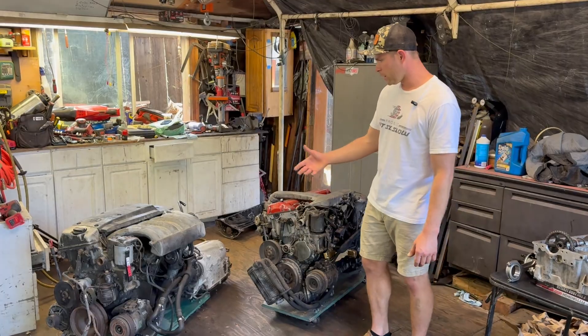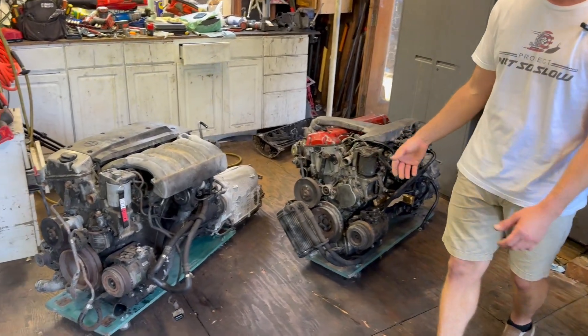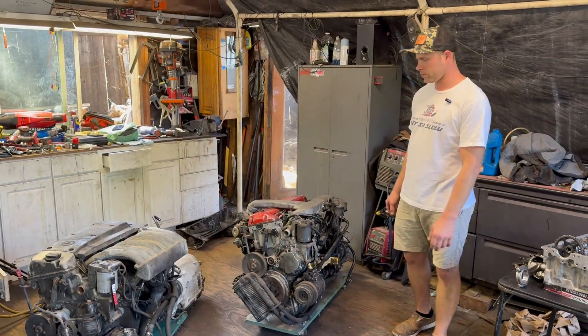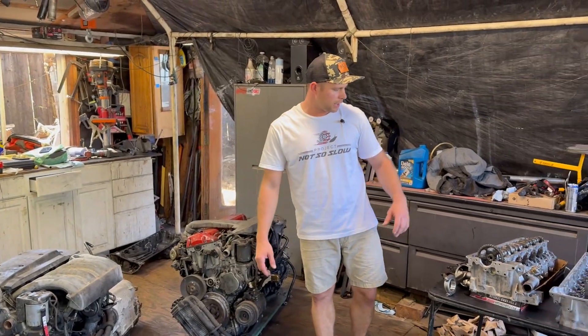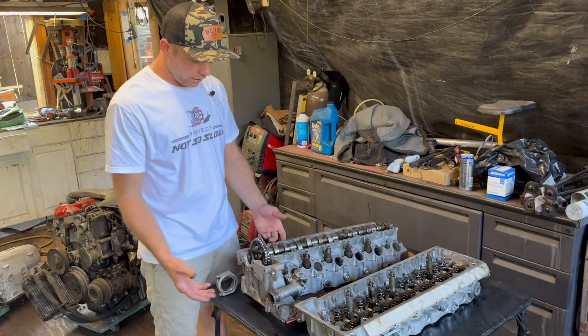Overall, the only real difference is the cylinder head — kind of the look. The injection pumps look similar, except the 603 has a mechanical pump, the one you pretty much use to make the 606 run in any car. And here we have the cylinder heads. The main difference between the 603 and a 606 is the cylinder head right here.